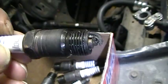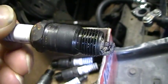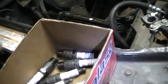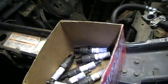We got some GT40P heads to put on here. It's a half decent short block with some miles on it, but it wasn't running on all cylinders all the time. There's number eight spark plug - the PCV screen is clogged up, which'll do it every time. You can see all the other plugs look great, but the oil gets into number eight cylinder and fouls the plug. As far as checking codes, we'll get it running right first.